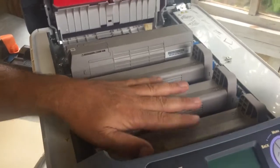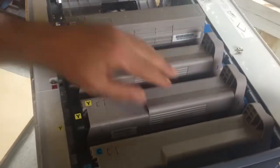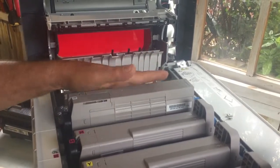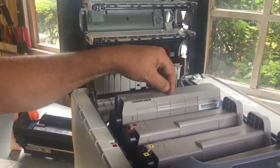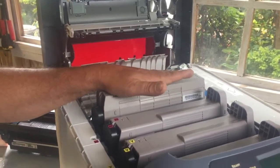So the top of it looks like that when you open it. The delivery toners are exactly the same — these are the delivery toners, which are kind of half the size. You'll see that the white we give you on delivery is a full 300 gram toner — it's 100 grams more than any other machine on the market. We supply that new with it because white is used almost four times more than any other toner, due to the under base that is put onto the page.